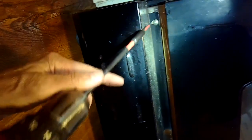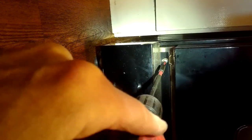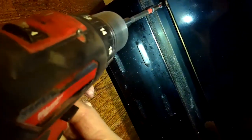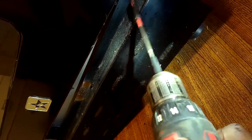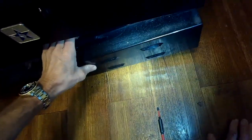The front panel is pretty easy — it has two Phillips head screws at the top. The ones on the bottom you don't have to remove; just do the ones on the top and then slide the panel up to get them off the bottom screws. Get the two off on the right and left hand side. Once you get that panel off, you have good access to the wiring for the igniter. In this model it just has one igniter, so either one of the wires coming from the oven to power the igniter can be hooked up to either one of the new igniter wires — there's no polarity issue, so don't worry about that.